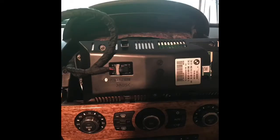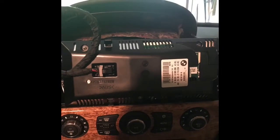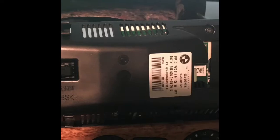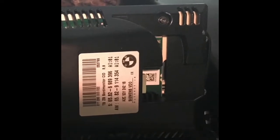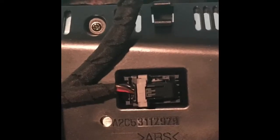After removing the air vents, I removed the two screws following the directions — the two screws that hold the screen in at the top. This is the back of the old BMW screen. It has two connectors, one on each side of the actual screen, so you just disconnect those. This connection here is a little tricky — you have to hold down the black part in the middle and slide the gray part to the right.